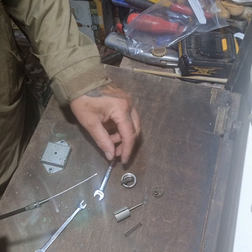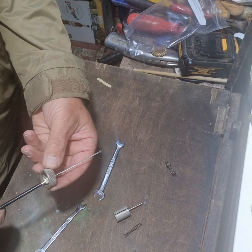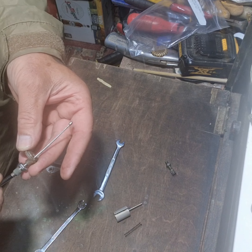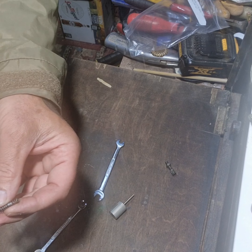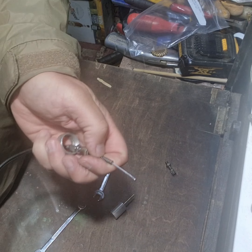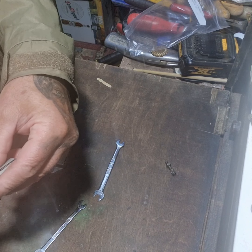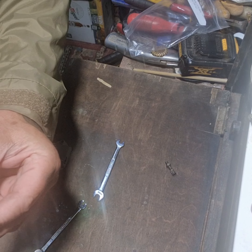It's actually come with a new bit of its own — one of these — but I'll keep hold of that. So basically, don't forget to put that on or you'll be cussing yourself later. Push it through there and just slide it all the way. Don't forget your spring — put the spring on the cable. Just push the excess through, keep your finger on the end, hold that through like that. Just clip it inside there, drop the spring in, and basically we're ready to install back into the carburettor. That's how simple it is — there's nothing to it.